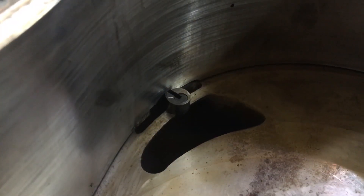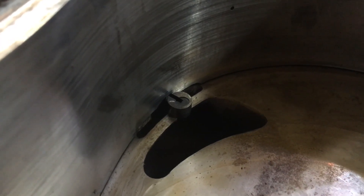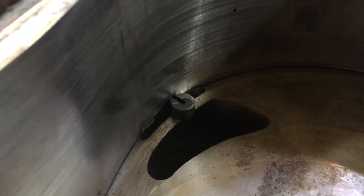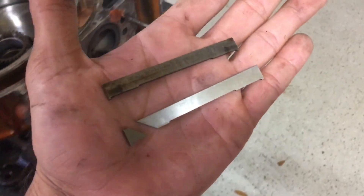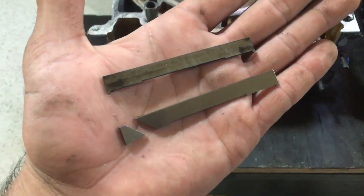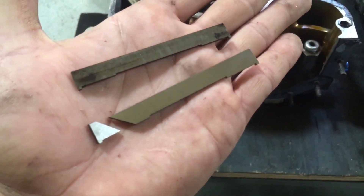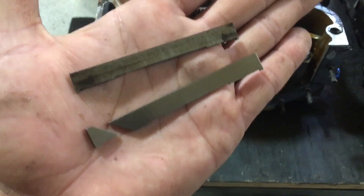As opposed to mine, Cat's supports the corner seal from the middle and not from the outer edges. These are the two apex seals I'm going to show you — on top is a used one-piece, and on the bottom we have a brand new Atkins two-piece.